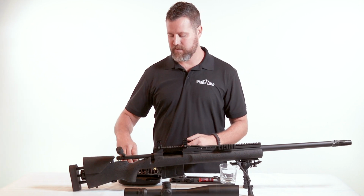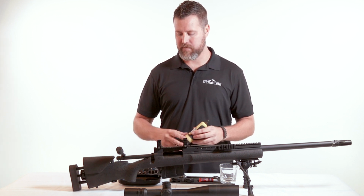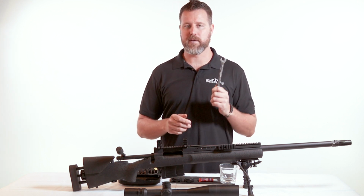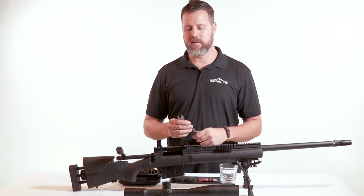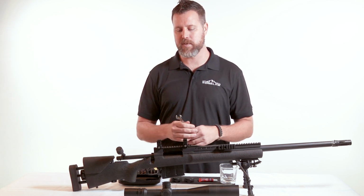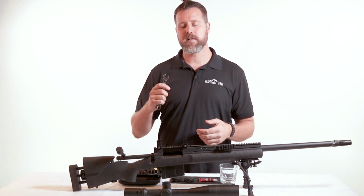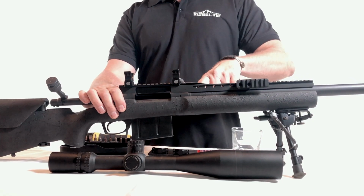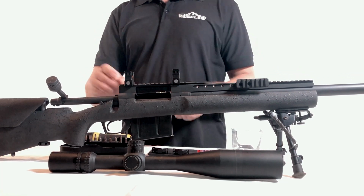You can use the Wheeler fat wrench with a 1/4 inch bit adapter to a 1/2 inch socket. Or you can do the old school method, which I'm going to show you today too, using just a regular 1/2 inch crescent. The old school way of doing this for your traditional steel, or in this case steel-titanium hybrid rings, is to tighten it down hand tight, and then come in with a crescent wrench and make a 1/4 turn. When you make this 1/4 turn, this is bringing these rings to just about 65 inch-pounds right there.